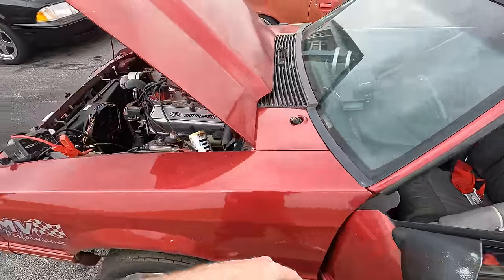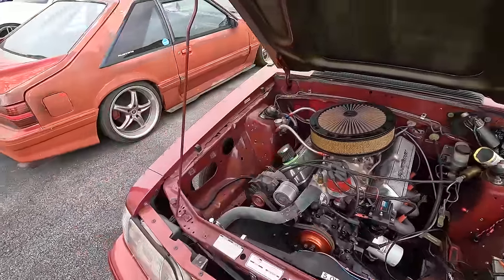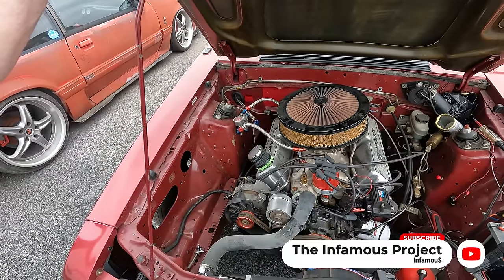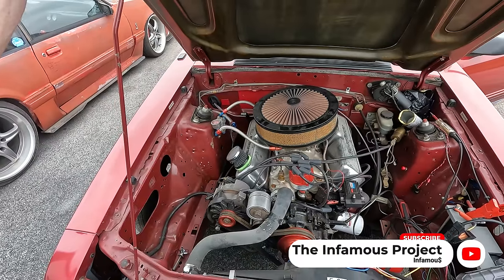Let's go get some more fuel — I actually hear the coolant moving around in the motor. Of course my booster pack is dead. We know that this car is ready to fire up. It's windier than I would like — I don't want the hood blowing up and getting off the rod and smashing the cowl or anything. We're going to wait till the wind dies down, try to get a battery in here that can actually hold a charge, and get a more consistent way to feed this thing fuel. But it wants to fire — all it was, was a bad coil. All the other wiring, even with that positive wire, who knows. We don't have a fuel pump and the pump could be locked up — that's maybe why it doesn't want to engage. The other switch was going to at least one of the wires down to this box down here. It's carbureted, so really doesn't need much — as long as the coil and distributor are doing what they need to do and it's getting fuel, she's going to fire. As she did.